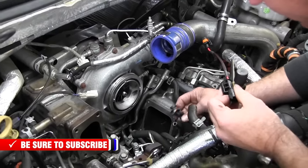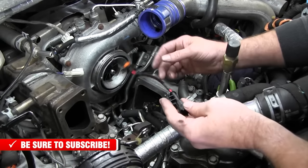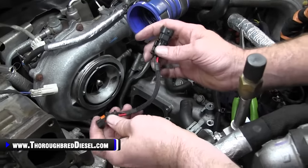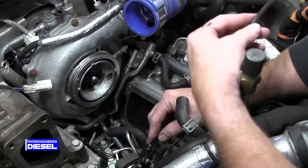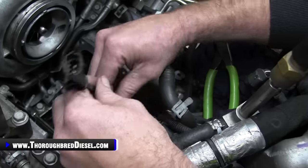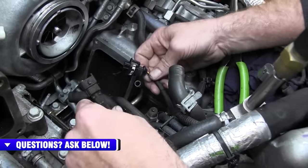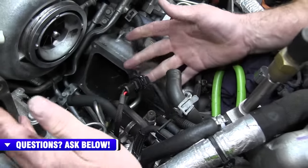We wanted to cut into the wiring harness portion of our video. This is going to look a little bit weird to you because we're farther along in the install, but we wanted to come back to this and show the wiring harness. Inside of the CP3 conversion kit, Fleece sends you a CP3 FCA actuator harness extension. If you try to run the original OE harness back to the CP3, it's just a little bit tight. So Fleece sends this really nice extension, and we'll install it while all of the lines are on, save for the supply line. You just go ahead and push that in until it clicks on your CP3, and then hook it back in to your stock harness until it clicks as well. And then you can leave this up and out of your way.